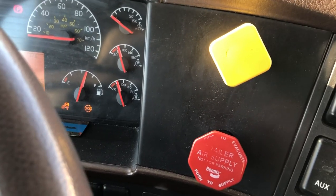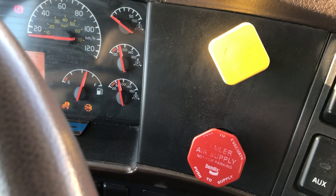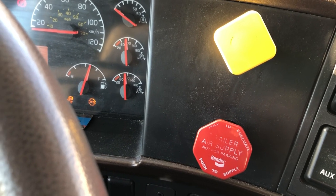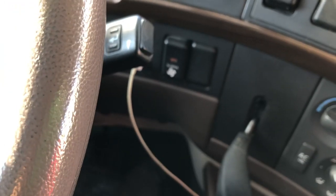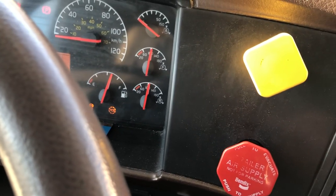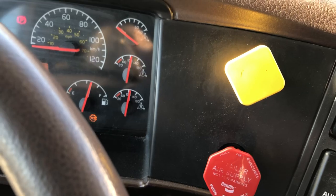Let's build the pressure and do this at 90 PSI. We reached 90 PSI and I apply my hand valve - I hear no air leaks from the blue service line. That means my tractor protection valve is closed and working fine. We are done with the red and blue line test.